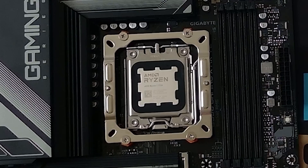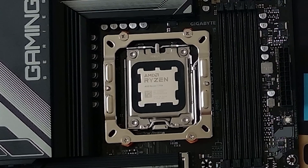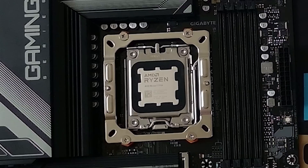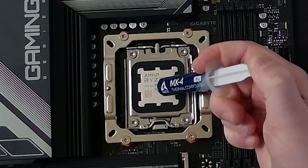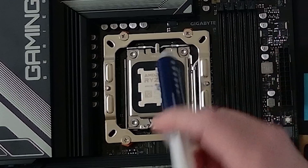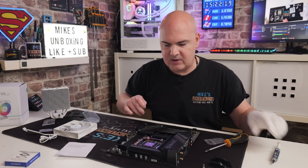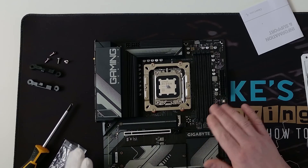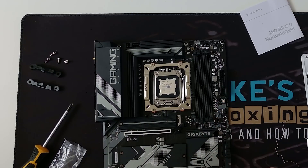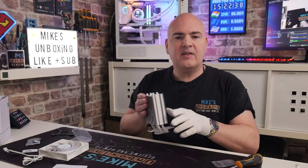Next is applying the thermal paste. You can use the thermal paste included in the kit, or paste of your choice — I'm going to use some MX4. All you need to do is either put a small blob in the middle, or spread the paste out if you prefer. For this demonstration I'm just going to put some in the middle — just a small grain-size of rice is absolutely fine, though depending on your type of rice, yours may be slightly bigger or smaller.